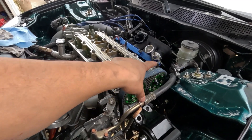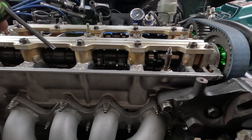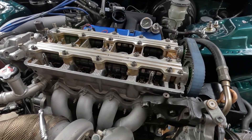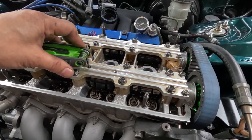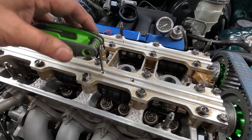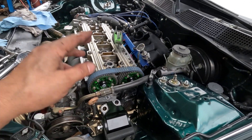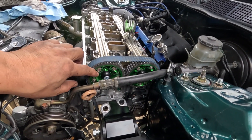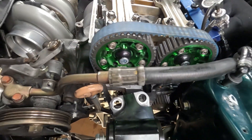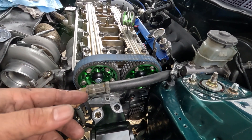Just to verify that your camshafts are all aligned, all you need to do is get the correct size tool — the camshaft has a hole in it, and you just need to line up something that will fit in there. Right there — it goes in. For the intake side, it's on the forward side. I'm all good; it's not binding, I don't have to push it hard, it goes right through. It's good.